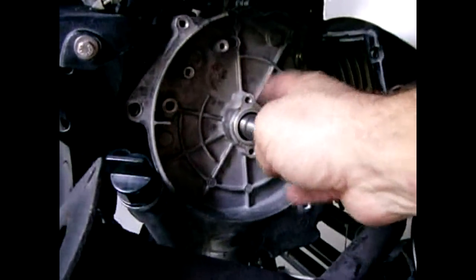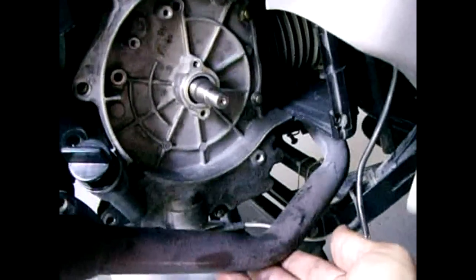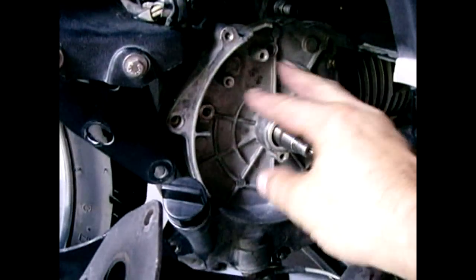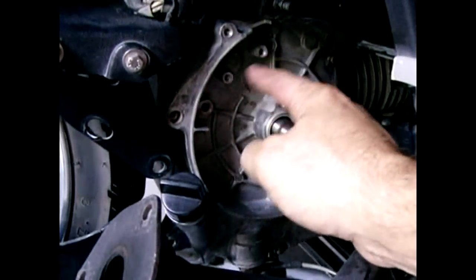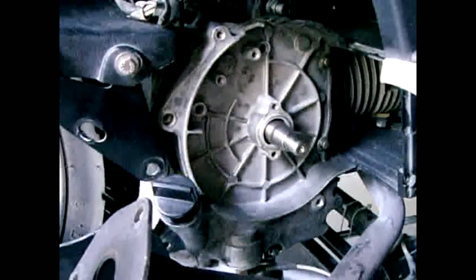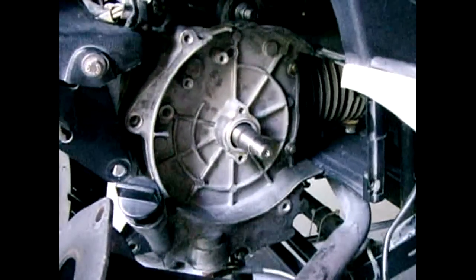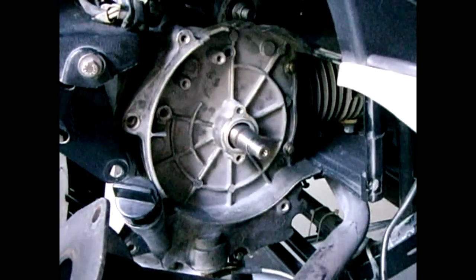The cover is back on, all bolts tightened securely, the oil drain plug is back in, and oil is back inside the crankcase. Now putting back the shock, bolting that back, pushing this plate back into position, retightening the exhaust system. When you put the stator back in and the pickup coil, make sure the stator is pointing in the right direction and make sure the pickup coil has about twelve thousandths of an inch between it and the magnet on the flywheel. If you enjoyed this video please rate it a thumbs up, subscribe, and post links to this video. Thank you very much for watching.